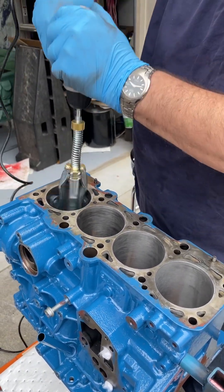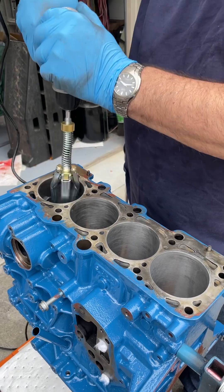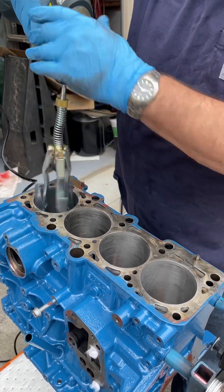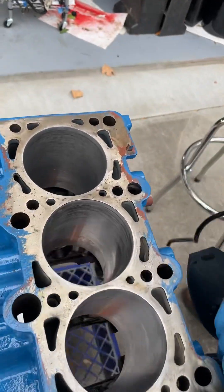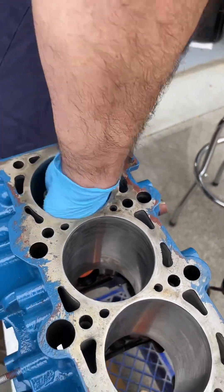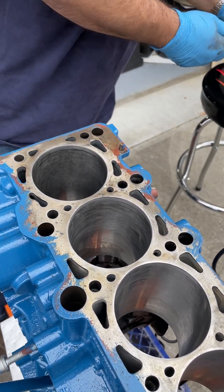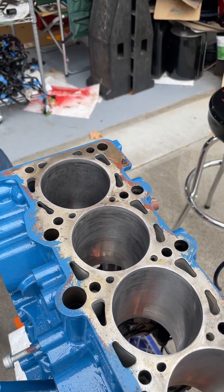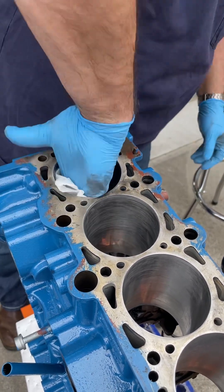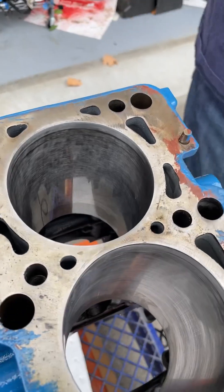After counting through 15 strokes, if you look in there now and wipe it out, it'll look a lot like that second reference cylinder. Get a little more gasoline on this — you don't have to use expensive lint-free rags on this, it's just a cylinder. Looking in there now you can see some of the dark and light areas.